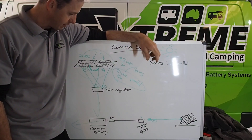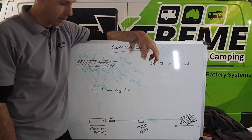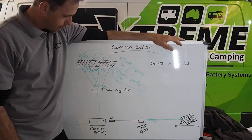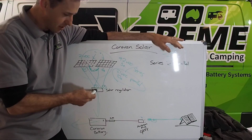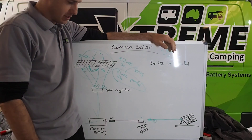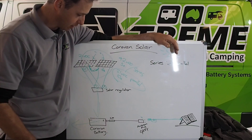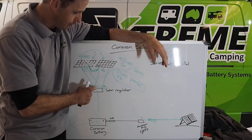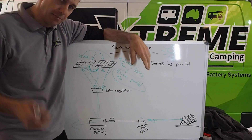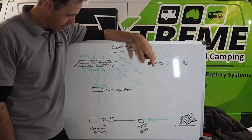Use MC4 connections as much as you can on the panels — we tend to do them as well. They plug in great and make panel replacement easy. If you ever drop a spanner on it or shatter a panel, it's nice and easy to plug a new MC4 connection straight in. So that's a quick, simple rundown of how solar works in the van. Keeping the charge regulator really close to the battery is definitely the right move. All the new monitors out there — especially the Victron stuff — mean we're able to do it properly, having the charge controller really close with its own separate monitor. The all-in-one system is okay for small amperage setups — maybe one panel, two tops, 10 amps or so — but anything more and it just doesn't really do the job. Keep it close and you'll be fine.